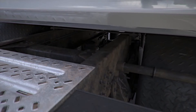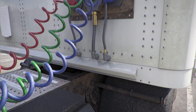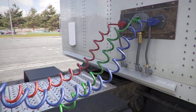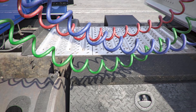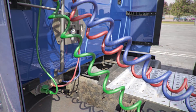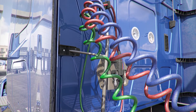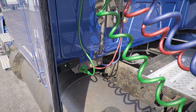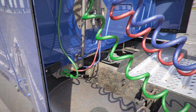Air and electrical connections between the tractor and trailer. Air lines: each of the two air lines is properly mounted and secure at both ends, with no abrasions, bulges, or cuts, and is not leaking air. Electrical cable: properly mounted and secure at both ends, with no abrasions, bulges, or cuts, and no exposed wires.